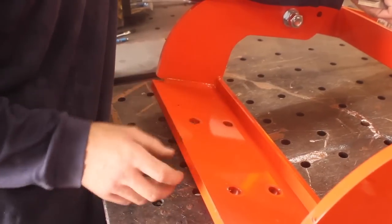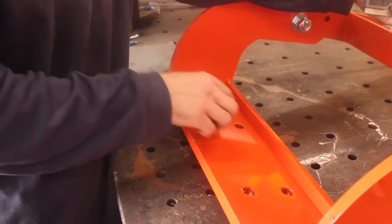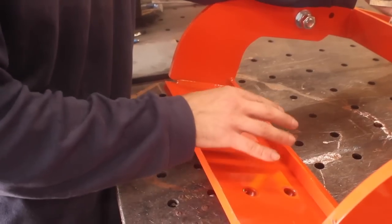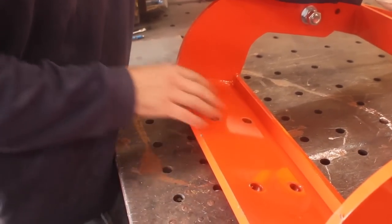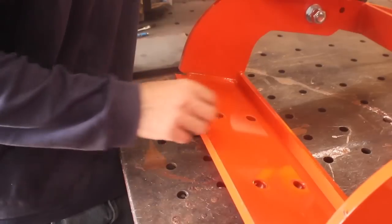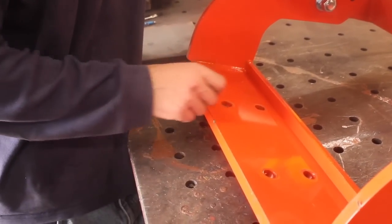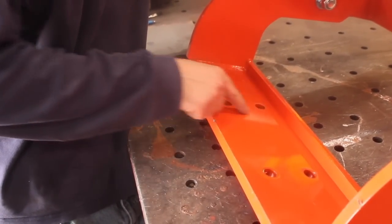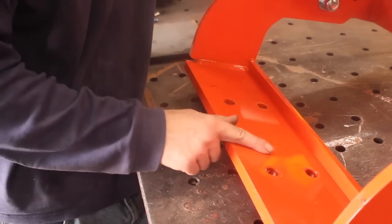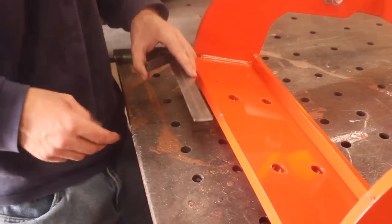It's fairly important to not put the D-ring directly on what it's going on. If you put a plate between the D-ring and your original steel — so you've got the D-ring, the plate, and then your original steel — when something pulls on that D-ring, the plate distributes that force. Instead of being concentrated into a small area, it's distributed into a large area. It's much easier on everything, reduces fatigue, reduces cracking, and that's what we're going to be doing.